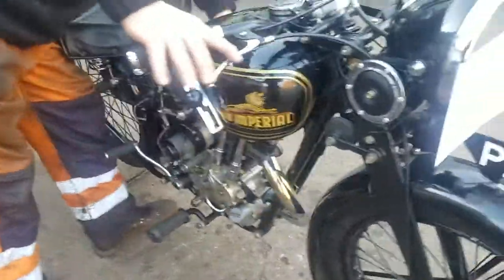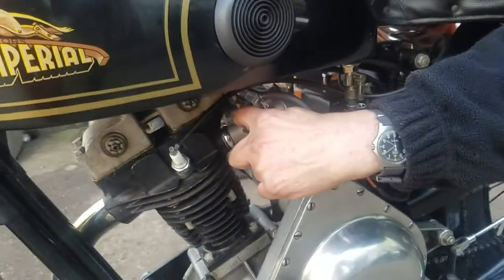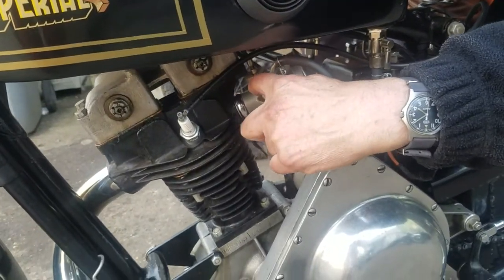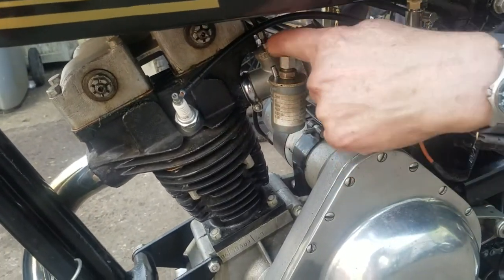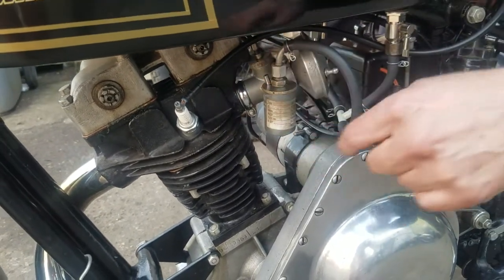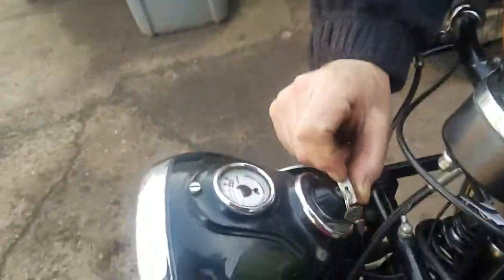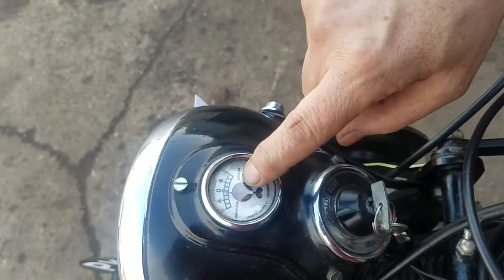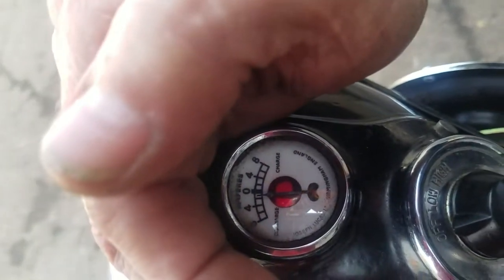So, let's see its virtues then. Tickle it up there — that really is a miser's carburettor, that one, isn't it? They're tiny, aren't they? It's been reconditioned by Martin Bradbury. Tickle it up, turn the ignition on, you see the ammeter deflect, and you can just about see the little light on there.